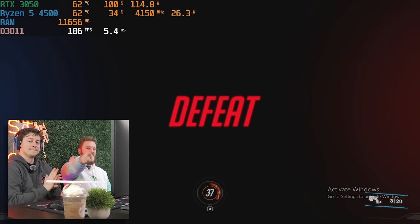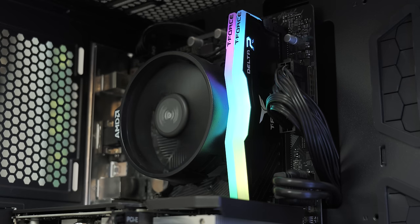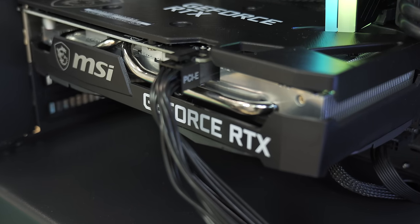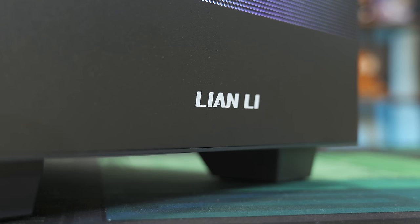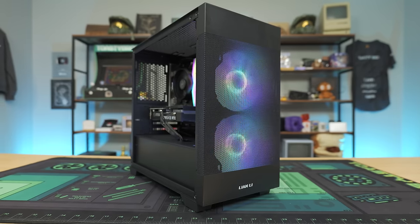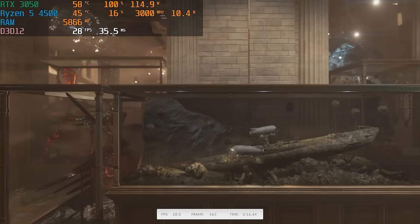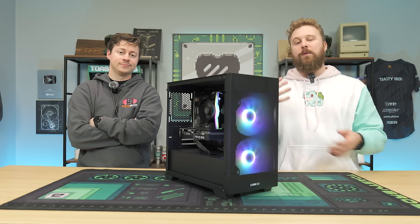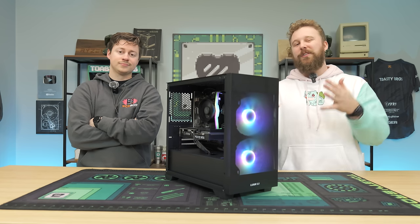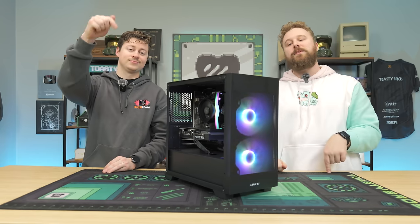Now that you've built your gaming PC and we helped you benchmark it, it turned out really good. We were able to play eSports titles like Overwatch at pretty much max settings at 1080p and got a high refresh rate experience. AAA titles, because of the 3050 really carrying that 4500, are no slouch either — Warzone ran great at 90 to 100 FPS on balanced settings taking advantage of FSR and DLSS. In terms of 3DMark Time Spy, we ended up with a score of 6,270, which comes out to a 10 cents per point score — the same as the RTX 4060 Lenovo we looked at in the Walmart versus Best Buy video. If you want NVIDIA and want to buy new, this is probably your best bang for the buck option. Let us know in the comments what you think of this PC, and if you want to build one yourself, use the affiliate links in the description below.